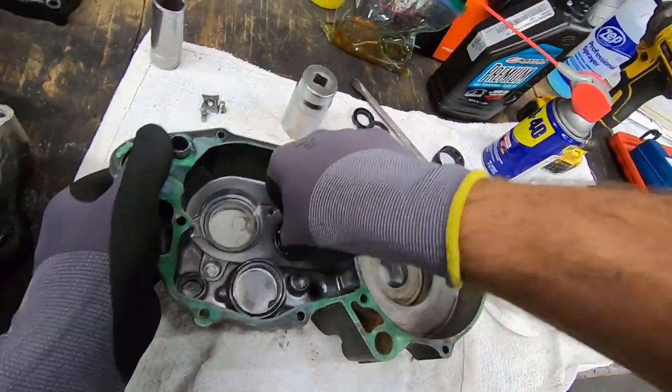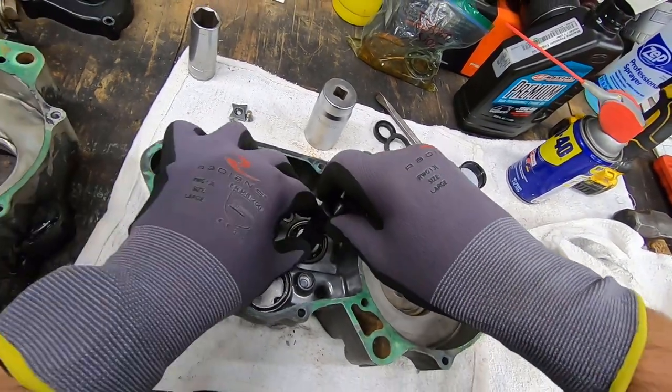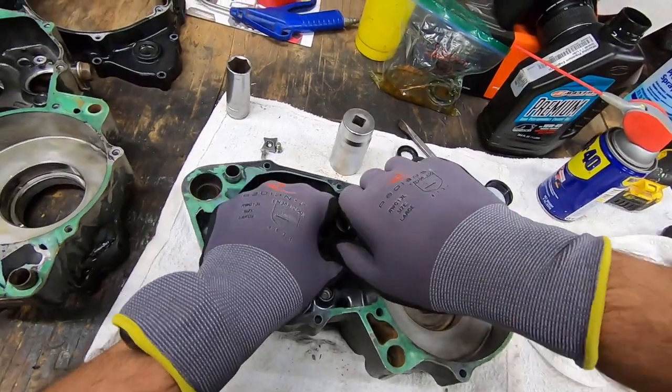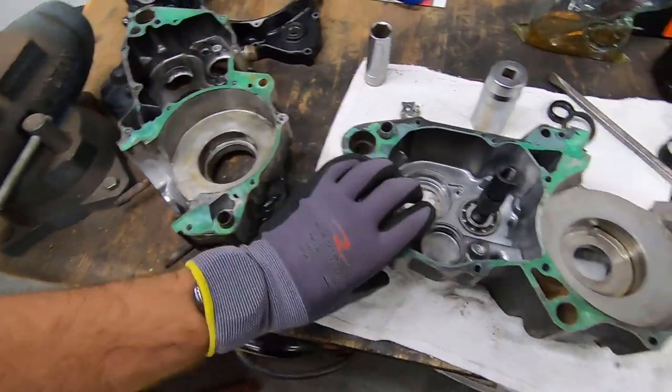inside the inner race. And the teeth on the back of the collet, you hear it? It's gonna grab on the back. Then you just tighten these two up. I don't think I need to wrench tighten these. Had pretty good retention. Then I'm gonna go ahead and use a little bit of heat on the back side of this.